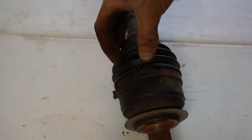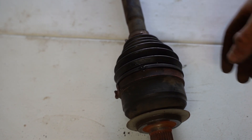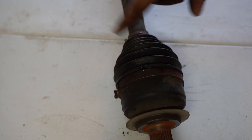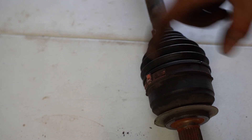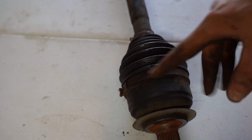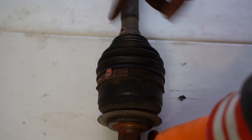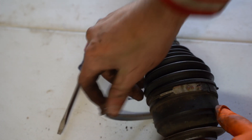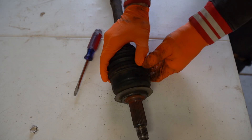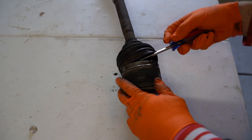We got her out. As you can see right here it is leaking a little bit — that's where the little hole is — so we need to replace the boot. What we have to do first is remove these little clamps: just take a little screwdriver and pry them off, then pull the boot back. There should be a little clip inside and we can pull this whole piece off, pull the boot out, put the new boot on, and go from there. Both clamps are off — go ahead and slide the boot back.